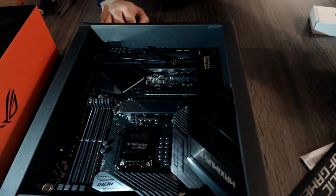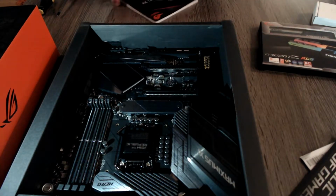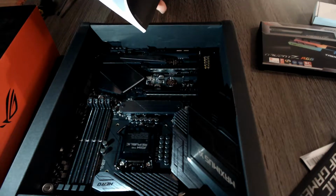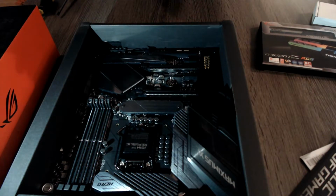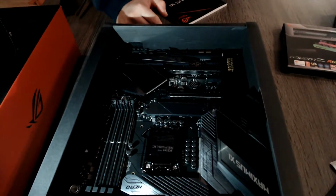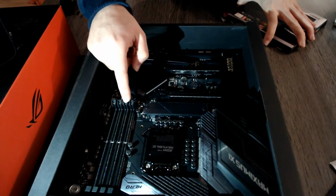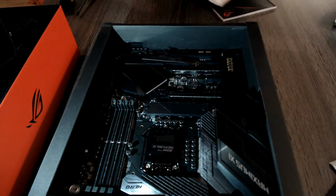Now, because your motherboard is a dual channel motherboard, you will have to set up your memory properly to take full advantage of its speed. Otherwise, you are going to be crippling yourself and not utilizing the speed fully. You can check which configuration this is either in the user guide, as you see here, with some recommended configurations, or it is also conveniently here on the board. It is a little difficult to see, it's not very focused, but it is written very specifically which are the recommended channels. In this case, it will be the second one here and then the fourth, according to the user guide.